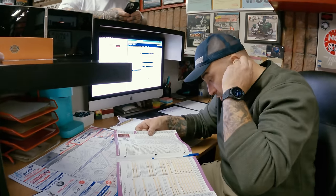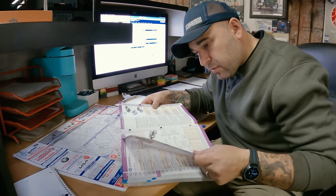If 618 is the biggest M8 camshaft they have, we're not using it regardless, right? We want to go one under the biggest, which is the 590. Which is the 592. If you want to go Feuling, that's the one. It'll be big, a lot bigger than what you have now.